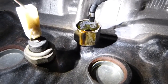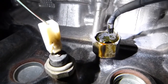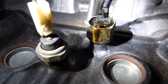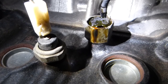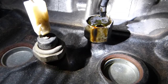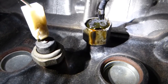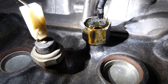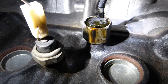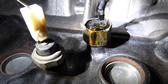Both of these sensors are mounted solidly in the engine block. The one on the left with the white electrical connector is the oil pressure sensor. The oil pressure sensor is basically a switch. When there is enough oil pressure circulating inside the engine, that oil pressure exerts a force on a push plate with a plunger against the spring, which compresses it. The plunger at the end of the spring push plate closes the electrical circuit between two contact points.